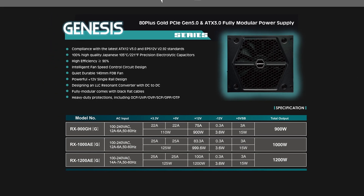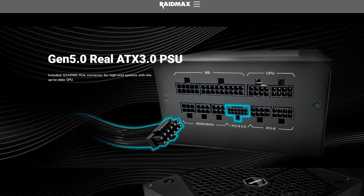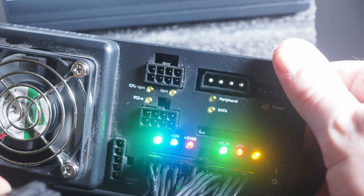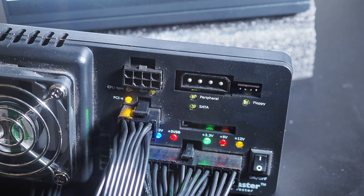Spec-wise, it's straightforward: 1,000 watts, 80 Plus Gold for its grading. It does have the 12VHPWR — or PCIe 5 — which is very important for the new generation of graphics cards. Its AC rating is anything from 100 to 240 VAC, which means it works pretty much anywhere around the world. I am waiting to afford my full PSU tester — they're very expensive — but Coolermaster did send me a power supply tester that shows it works. I also went through all of the test sheets to confirm it passed all the different specifications, pretty much everything on the TUV Rhineland specs — about 40 to 50 pages each. It is a good power supply and has passed all the tests it should pass.